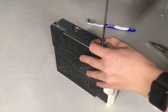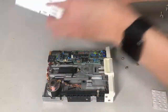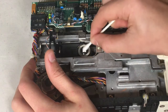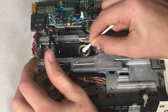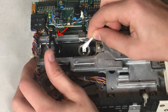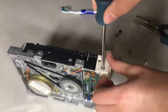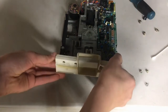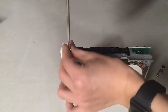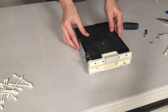I'll go ahead and remove the screws holding the cover on the built-in 5.25 inch floppy drive as I want to clean the read heads and do a few other maintenance tasks on this drive. One thing to keep in mind is that you will have to clean the read heads on these Apple II drives manually no matter what type of Apple II drive it is, as these are all single-sided drives. Therefore using a cleaning disc on these would likely damage the felt pad that presses against the other side of the disc. I also went ahead and removed the four screws holding on the little front plastic piece on this drive as it was kind of scuffed up and I wanted to clean it off. I got it back on eventually, no big deal, and now it's time to work on the keyboard.